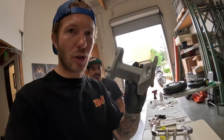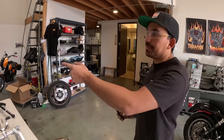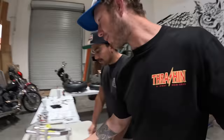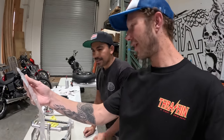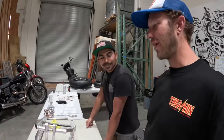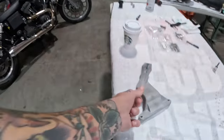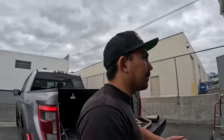We've got to take the mid controls and exhaust over to the polisher. We can bring the one we've been using and bring a second one for the second bike. I want to do the back brackets but that'll have to be last minute because we need to dimple die them. Follow their instructions — it says use red Loctite when installing the front pivot bearings, insert supplied set screws to lock in place. I feel like it means Loctite on the shoulder because you're never supposed to take them out.